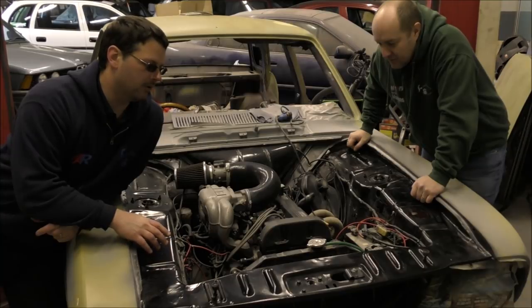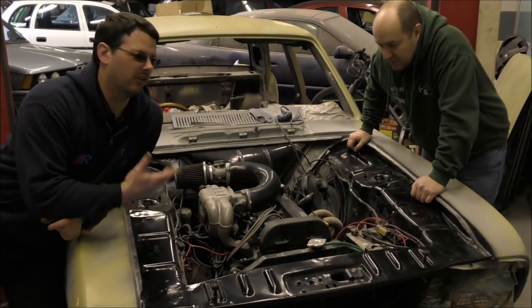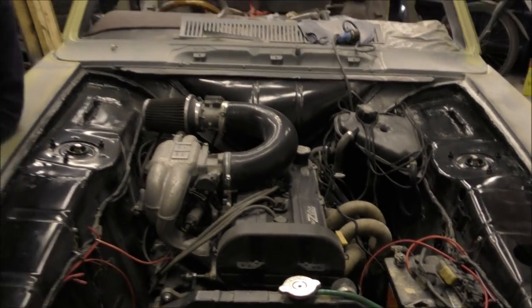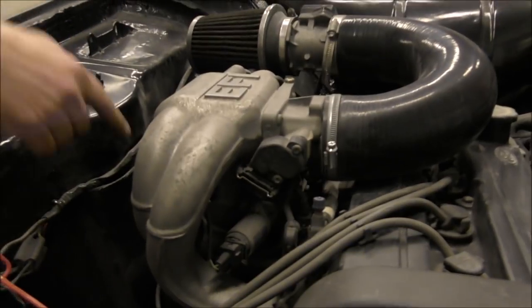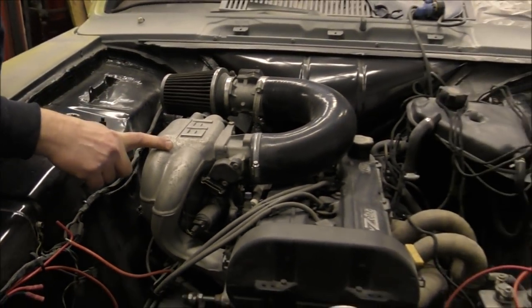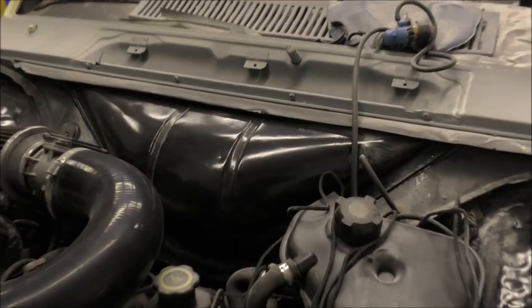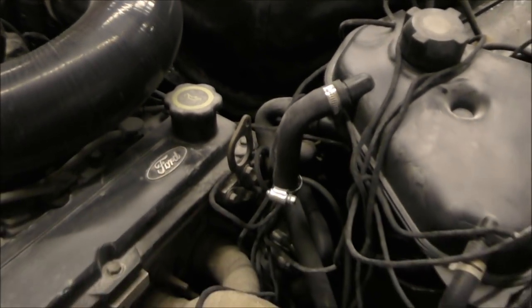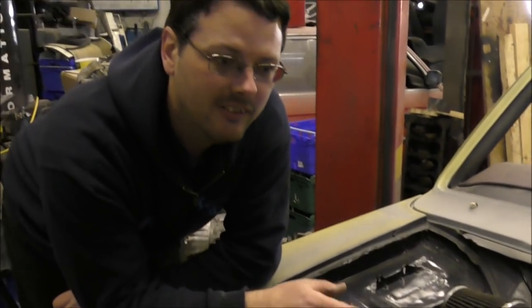So only a 1600. I didn't want anything bigger simply because it would have cost more, and I didn't want to mess around with brakes and suspension. This was almost a straight swap — it's a 1.6, however this is not the standard inlet manifold. The plastic inlet manifold caught on the steering box. So I need to replace it. Next was fitting the gearbox. I used the 1.6 clutch and a 2 litre Pinto clutch plate, and there wasn't enough throw on the clutch to release it. So I had to have a 2.6mm ring made to go between the flywheel and the pressure plate.